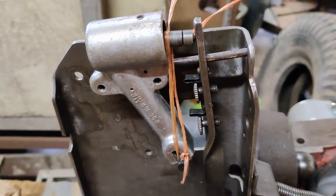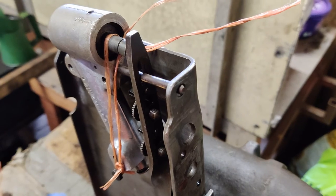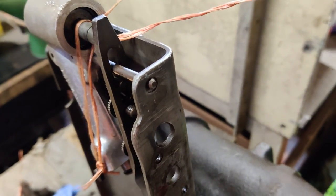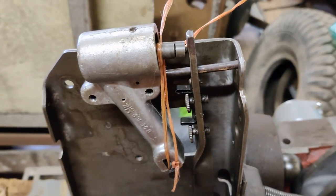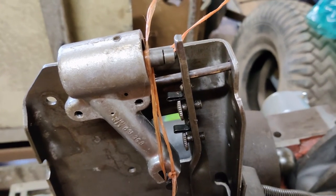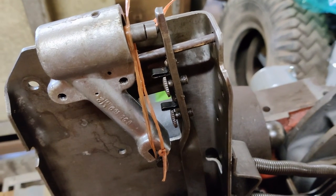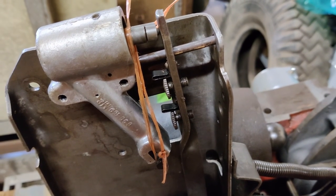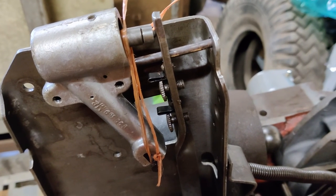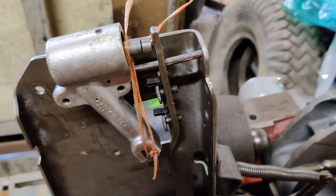There's your dashpot back in with a new guide. You'll see there's a slot in the vertical lever for it and a little hole in the support bracket. Just a quick tip for anyone who ever has to do this again: put a bit of string around the plunger on top of the dashpot when you put it in, because otherwise it'll fall out and all sorts of springs and valves and stuff will fall out and disappear through cracks in the floor and it will ruin your day.